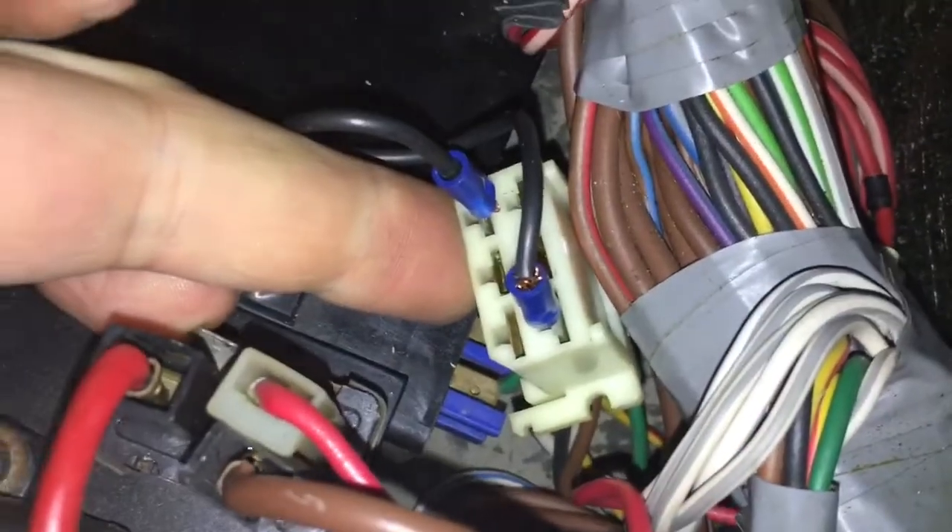Head into the back — I've already done this — open up the cover here, gently, with the power off on the car, lever out the plug just here from the blue socket, and then put in a jumper wire. All you need is just normal two wires. As you can see here, the bottom left and then the top connector. Those two there — put it in, turn the power on, or if you haven't got a battery car switch, it'll turn on automatically straight away, so no need to turn the ignition on.